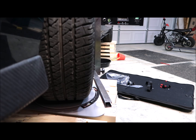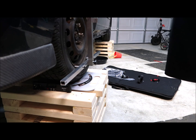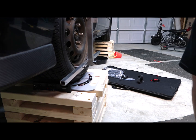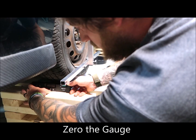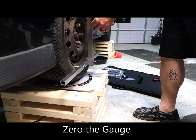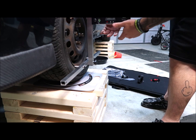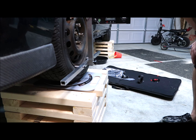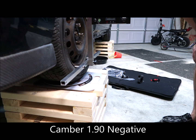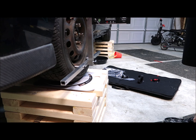So we'll go ahead and check the camber now. It's basically the same process, sort of. Now that caster is done, the camber is 1.90 on this side. It's basically the same step for the other side — I haven't messed with any of the camber settings in a while.